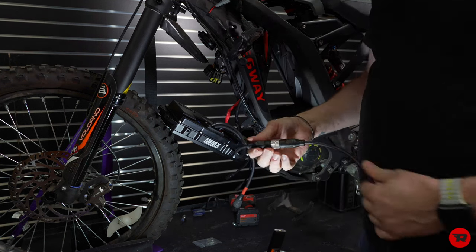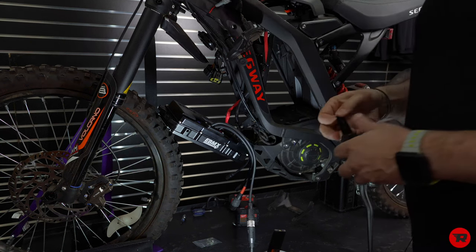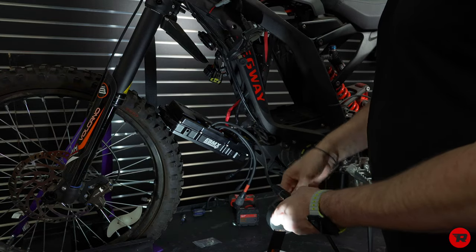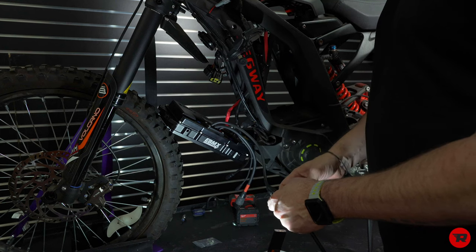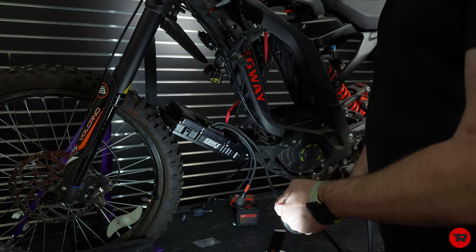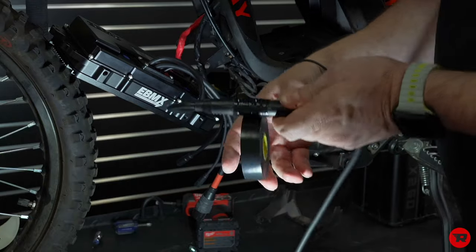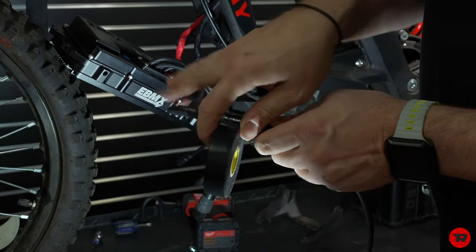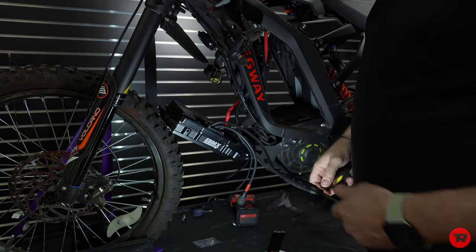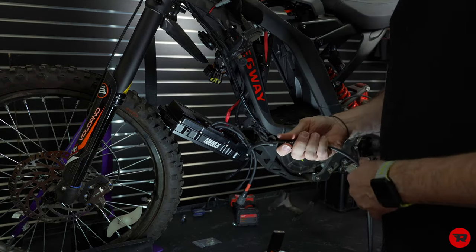And I'm gonna take this an extra step further. Even though these are technically watertight, I'm gonna electrical tape around these. Now, I don't know if you live in a wet climate, but we do. We're here in Vancouver, Washington. You could also look up Portland, Oregon. We are literally right across the bridge, less than a mile from Portland. So just go a little bit down onto the connector and wrap it on up. Gonna regret that later personally because I'm gonna put a version 2 controller in this, but I want you guys to know to do stuff like this.